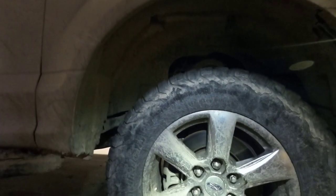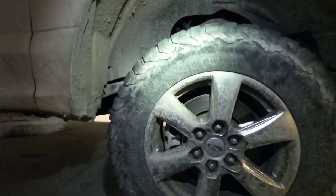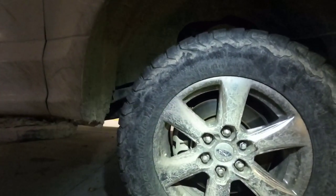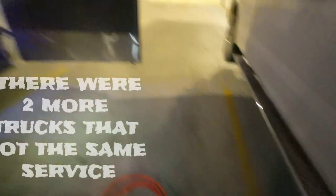Check the tire pressures, rotate the other side, finish changing the oil. Fixed the tailgate — this one's ready to rock and roll. We'll test the battery too, and I do check lights, all that good stuff. And we've got to get out all the tumbleweeds. That's a basic service.